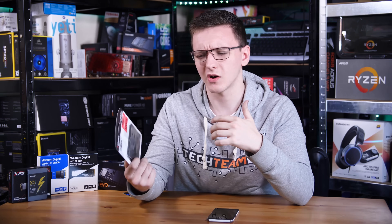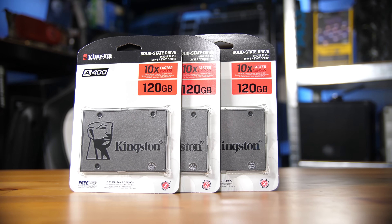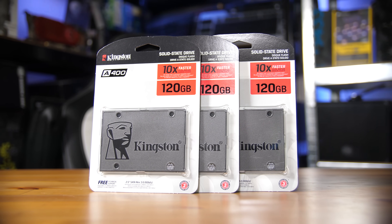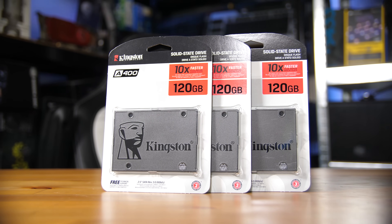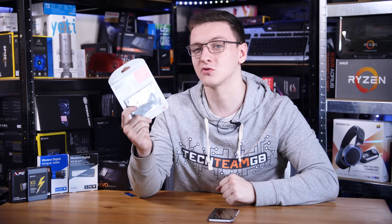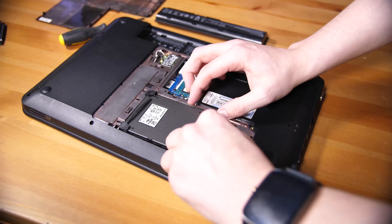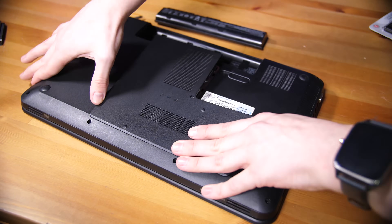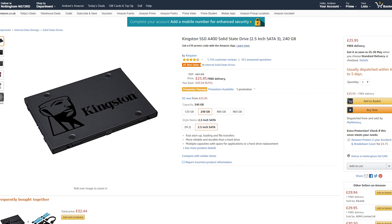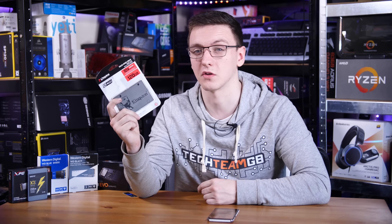So with that said, what sort of drive would I recommend here? It's pretty simple: the Kingston A400. These drives are incredibly cheap — they're not the fastest in the world, you're looking at about 230 megabytes per second on writes, which really isn't fantastic considering SATA SSDs at the high end can do 560 — but it's still very usable, very good for a laptop upgrade kind of thing. The price is incredible: you're looking at £26 for a 240GB SSD and about £48 for 500GB, so really very impressive and definitely worth a look.